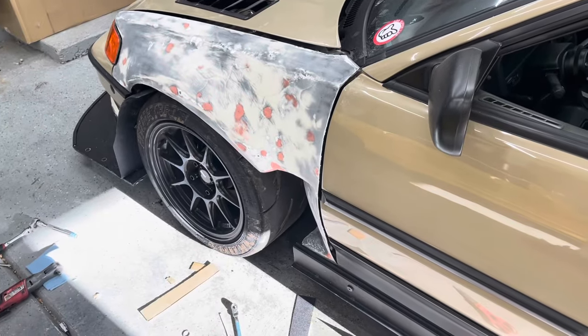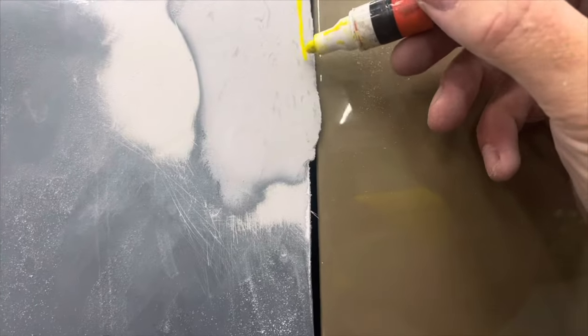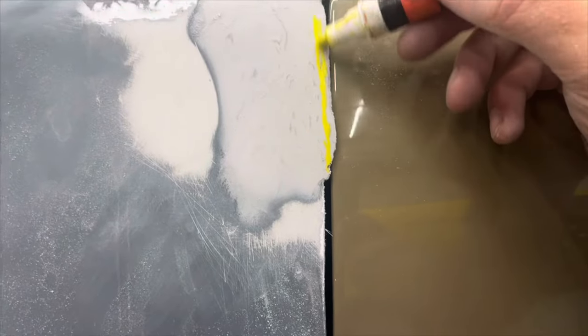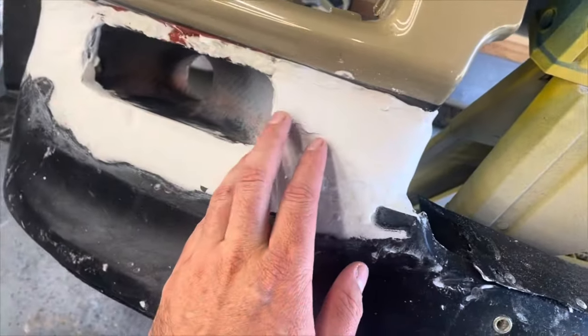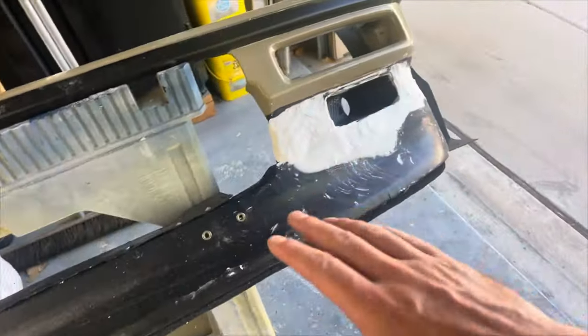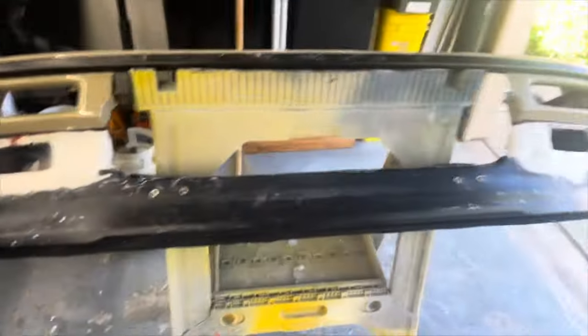This is not as good as the metal fender, but we can see where I added some extra material. Let's get a little closer. Here's the actual bumper — we're going to have to smooth a little bit of that out, but I think we're almost there. I'm just going to take some sandpaper, smooth that out, and resume once that's done. It hasn't totally cured — it should be 24 hours but we're probably at 16 or 18, and it should be good enough to work on.